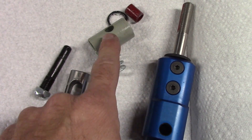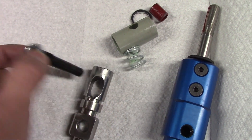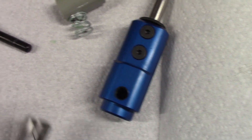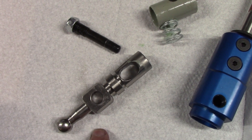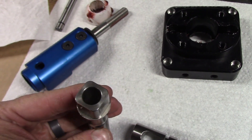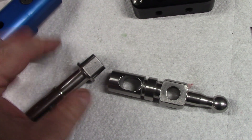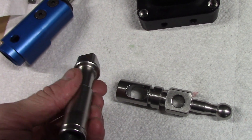Basically, you've got a spring, a bushing, an O-ring for some dampening, and a little cross pin that goes through the slot — it's what hits the little wall you've got to make. This basically goes in here and can go up and down to allow a reverse lockout. But this is obviously meant for the MT-82, so this fulcrum — or trunnion — has to get cut off and welded onto the Camaro base. The plan is to cut it off, turn a diameter that'll fit into the Camaro shifter base, so I could have a slip/press fit into here before welding, to have better structure and keep everything coaxial.